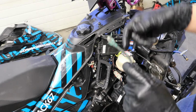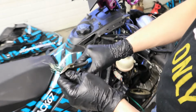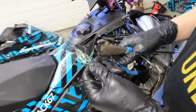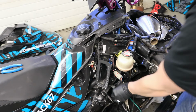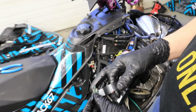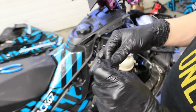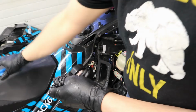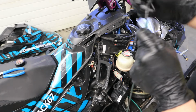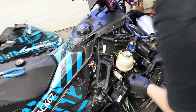Now this one's really frayed, but I'll use this just as an example. This Cobra cord, it's some good stuff, so try and cut it. It really doesn't like getting cut. So what we're going to do, take some tape. And I like doing this a little bit different than most, but I'll actually fold my tape over just because then you can get some traction on it. So now the end of your rope, it actually has tape on it, so it'll feed through stuff a lot better. So make sure to do this the way it needs to go.